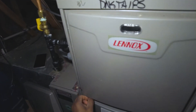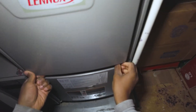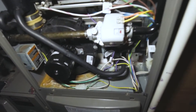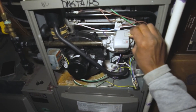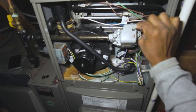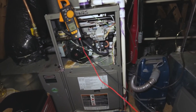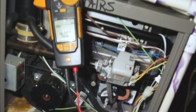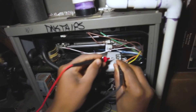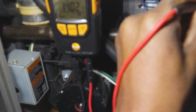What I'm going to do is check it against this unit, which has pretty much the same gas valve. The good gas valve is reading 400 kilohms. The bad gas valve reads 14 kilohms — so that's definitely going to be a bad gas valve.